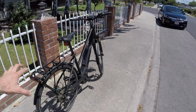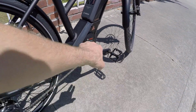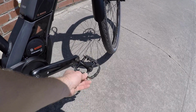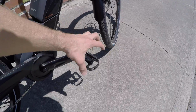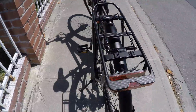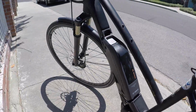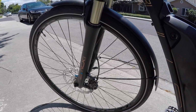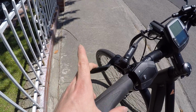You know, we've done a good walk around on the bike. I guess I missed the plastic chain cover, 170mm crank arms, the Wellgo cage style pedals. I'm okay with those. Sometimes I replace them with bigger ones just because I like to have that traction, but those are nice and light. Hydraulic disc brakes from Shimano, 160mm in the rear, and a large 180 up front because that's where you do a lot of your stopping, and you can just feather it with these 2-finger adjustable reach levers.